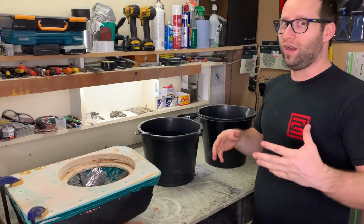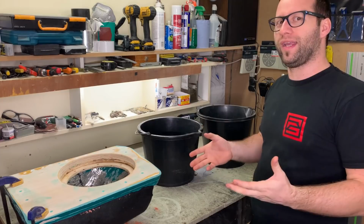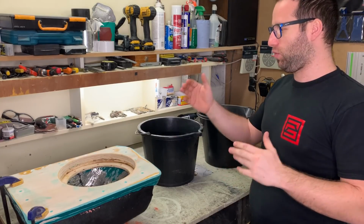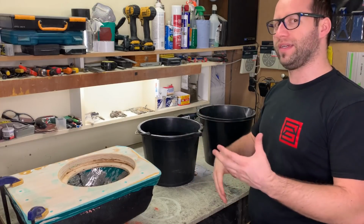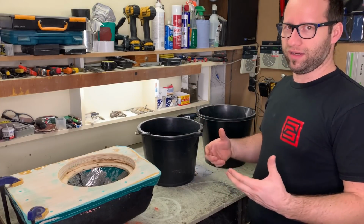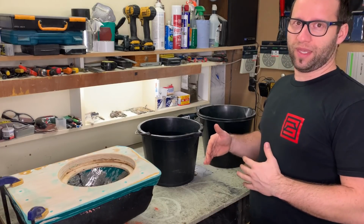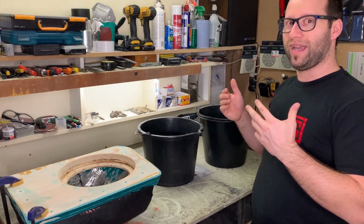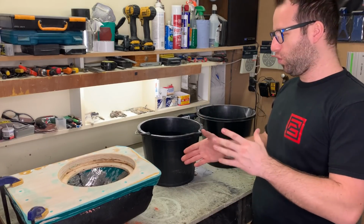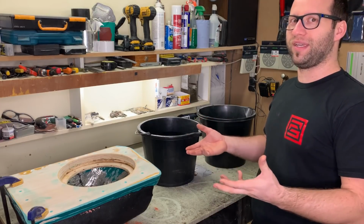As most of you know, I love this exercise. Somehow I just don't want to do any other way to test the volume in the enclosure. People always tell me that you should fill it up with this or that. It's not as messy as dealing with water. But the big advantage of using water to check the volume of an enclosure is to make sure that it's also airtight. Because if there's no water flowing out of it, it means there's no air escaping either.